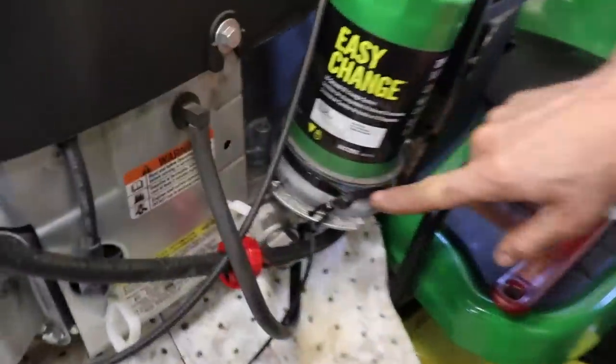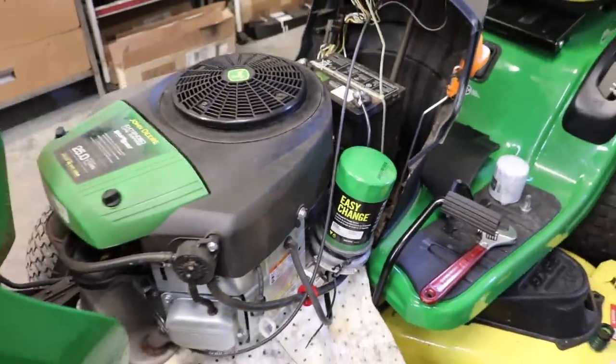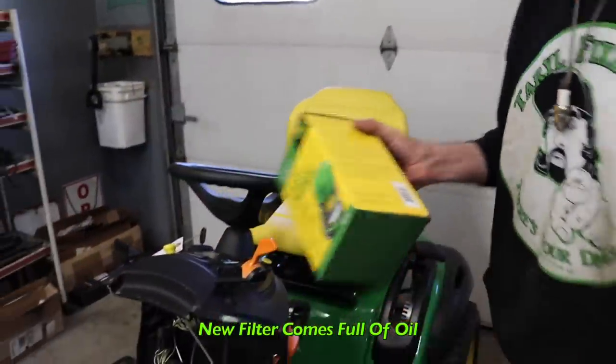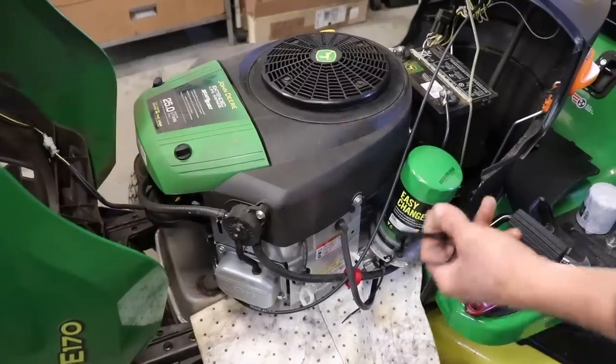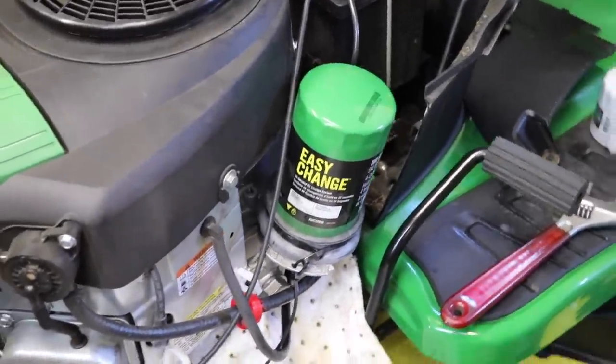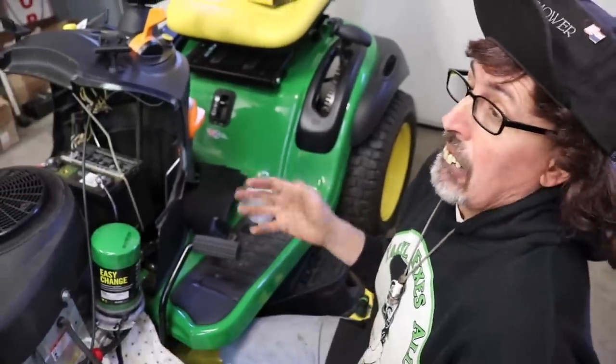I watched John Deere's video on how to change the oil and was reading through the comments. A lot of people were saying to take that apart, but you've still got oil in the crankcase — you're only changing out a little bit of oil, you're not draining all the oil out. So there is a drain plug. If you have one of these and you want to drain all the oil out, you can take the drain plug out, but it's going to make a mess. That's their whole idea — it's quick and easy, a 30-second oil change and no mess. So they tell you to take that oil filter off and cut the zip tie. If yours has got the zip tie on it, that means it's never been changed before. You cut the zip tie off, unscrew this, take it off, take the new one out — the new one is full of oil already. Put the new one in, turn it on, spin it on to lock it in. There's a rubber plug you can stick in the old one so you can discard it. Then you start the mower, let it run, and check the oil — if it's low you just top it off. People were saying there's still dirty oil in there, you're just mixing clean oil with dirty oil. So if you want, you can drain it. Quick and easy. Maybe you don't mind spending $40 to $50 for an oil filter, or you're a clean freak who doesn't want oil all over the place.